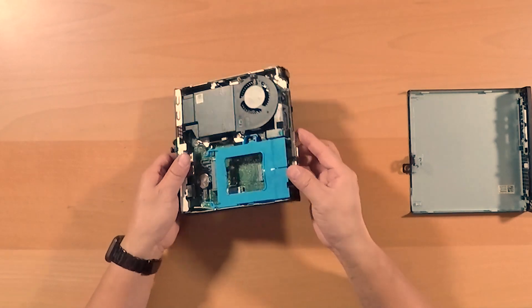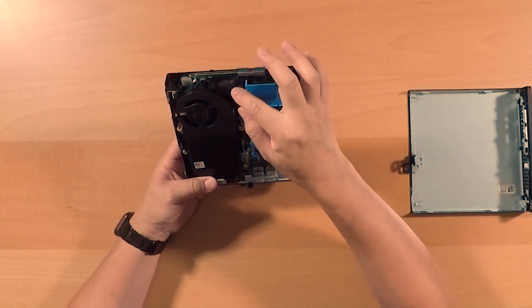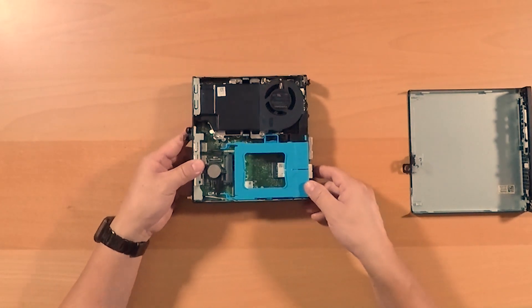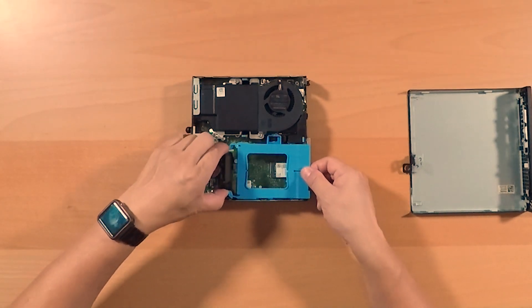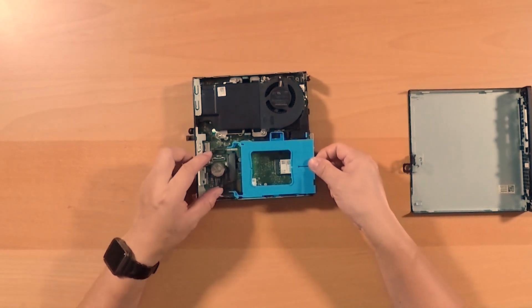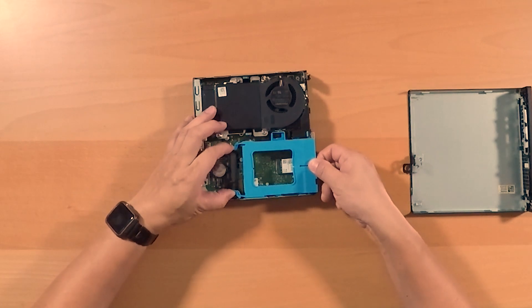In here there's a small speaker in the front. I highly recommend you get your own speaker if you like sound. Over here there's an additional slot for a SATA drive. To take it out, you push this down and bring it forward and up.